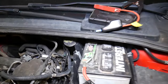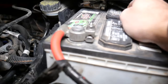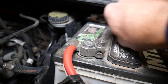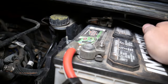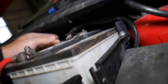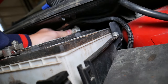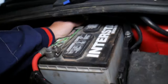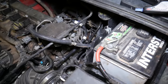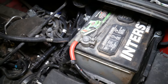The first step will be to disconnect your car battery. You need to do that because the battery is part of the airbag system. The correct way is to get the negative cable loose first. Always use gloves and always use eye protection, because the acid from the battery can burn your fingers and skin.